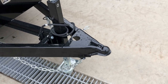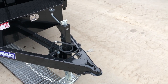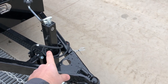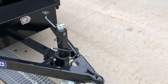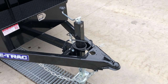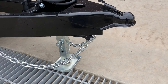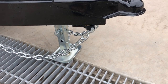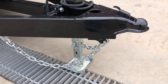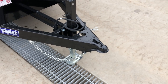Let's start up front and take a look at this trailer. It's a 2 and 5/16-inch stamp coupler. It does have the 7,000-pound drop leg jack — that is now standard. The setback jack sits back about 6 inches farther than the A-frame, which gets it out of the way and also gives you the ability to have the drop leg jack. You've got the top-line handle that winds the outer sleeve, plus an inner sleeve that gives you a lot more adjustment than a traditional bottle jack. No need to ever carry around a wood block — this gives you all the height adjustment you'll need.